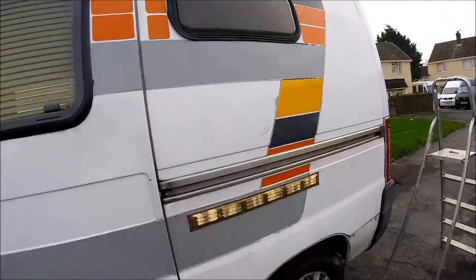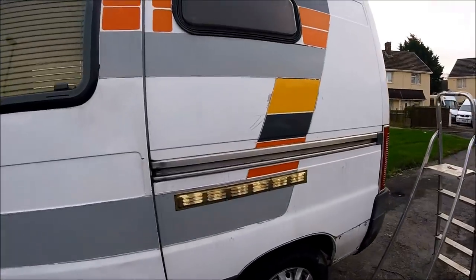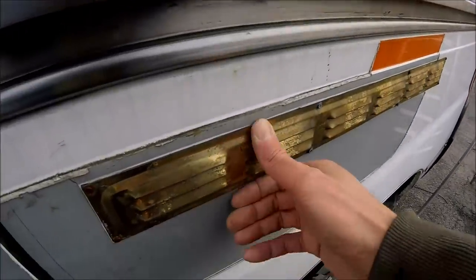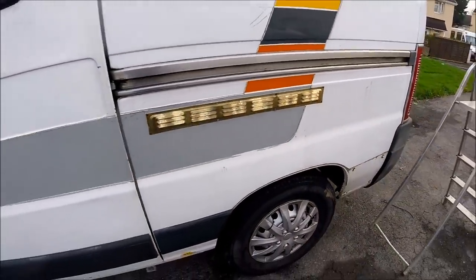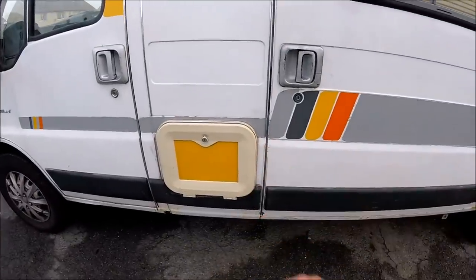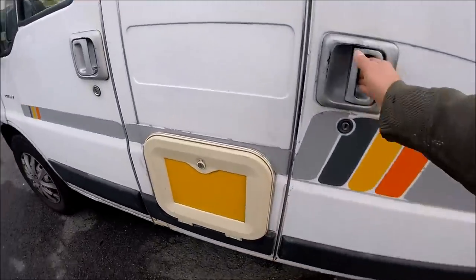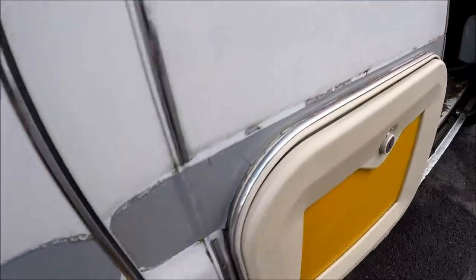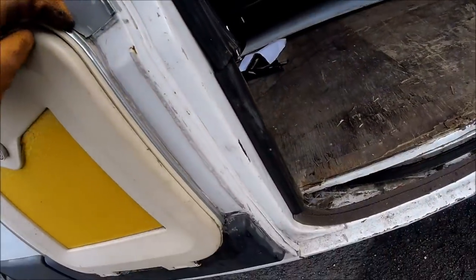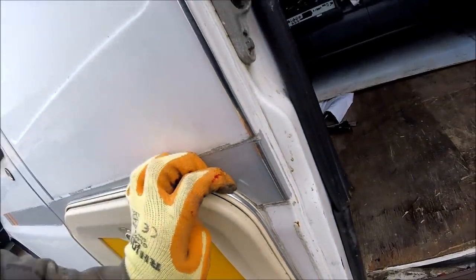The amount of vents on this van is ridiculous, and again all the vents have just been screwed in with no sealant whatsoever. There's a large brass vent along that side with no idea why. There's a Thetford cassette toilet flap on the outside, but on the inside there's absolutely no toilet — unless it's been put in as some sort of access hatch, but there are better ways of fitting an access hatch than using an old toilet flap. Even that has only a little bit of sealant around it and it's certainly not watertight — you can wiggle it around inside the panel.